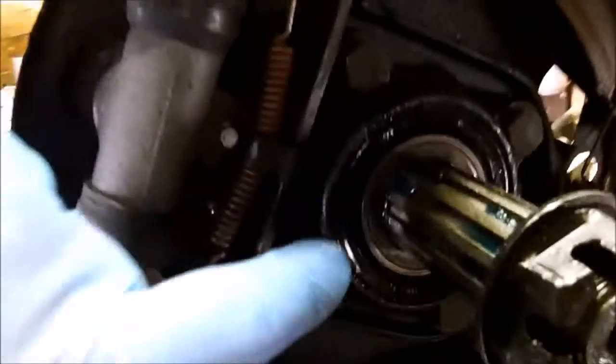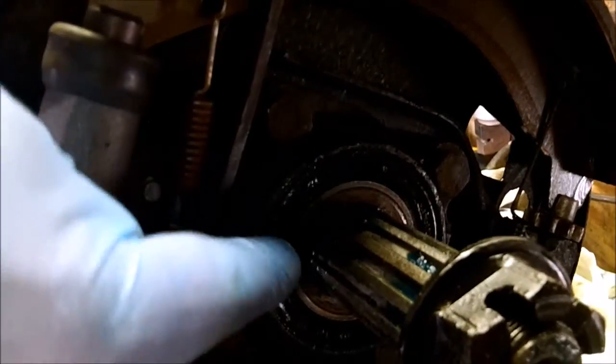They're not rotted off like the last three sets. Everything's ready to go. You can see that somebody had a bad drum at one point, and there's a little scratch on this spacer. It probably sheared all of the teeth off of the drum and it was spinning on this, so the car didn't budge. That's what happens when you don't torque this thing down. I've got to repair this, but that's not a big deal. That can be done anytime.